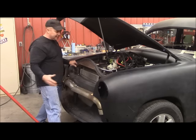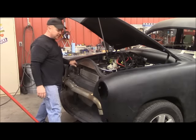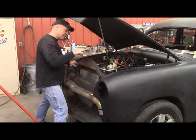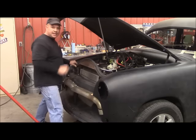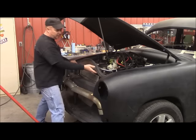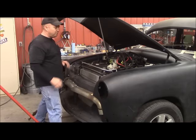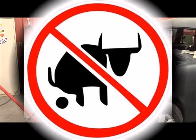Your top plate here that goes on here - you can see how close that fits and how beautiful that's going to look. It's going to look factory from 1950 and it's going to blend right into this Explorer just beautifully. When you open this hood up, it's going to take a minute to understand what you're seeing. Then I'll come in here and fabricate your inner fenders the same way, all in the '50s theme - all you want to see is that Explorer motor in there. It's working out just beautifully. Now I'm going to get your tie bar made, then fabricate your radiator mounts, do your inner fenders, and then we'll start securing the body down to the Explorer.